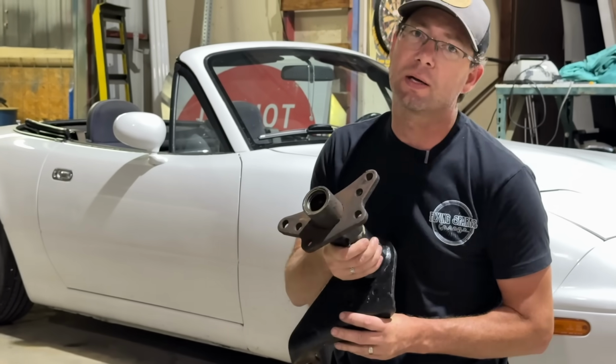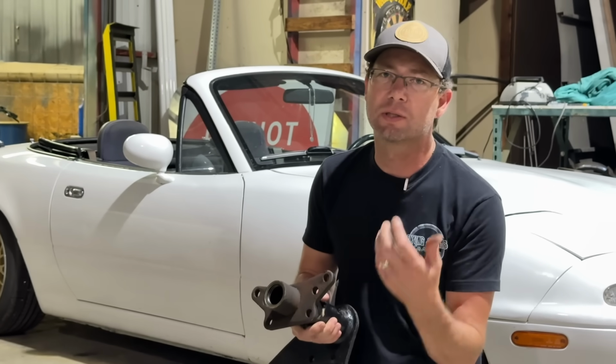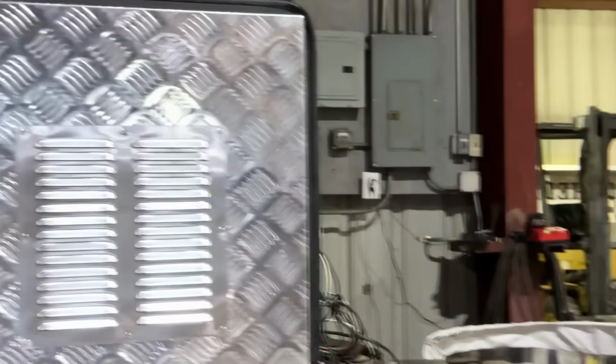We can get this bolted back on the truck, put the S-cam in, then we can start messing with the slack adjusters, get the brake chambers in, all that good stuff. Because we got to move this truck forward so we can get the forklift under that. Yep. Because Emily's going to show you what she's got to do.